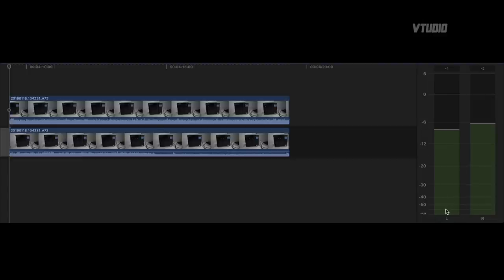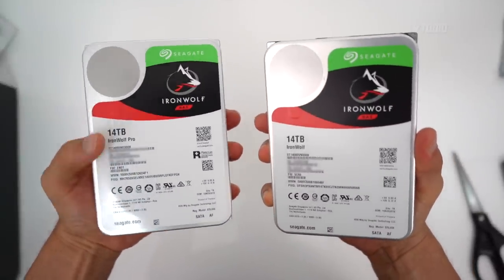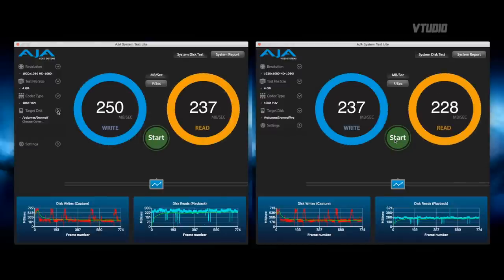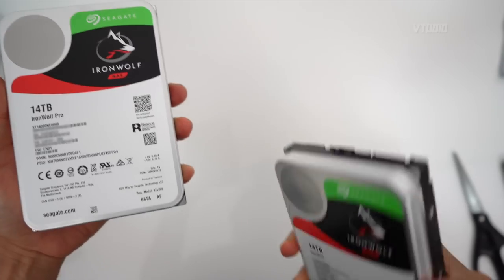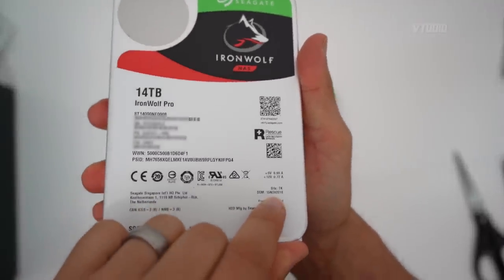With the Ironwolf on the left and the Ironwolf Pro on the right, the Ironwolf Pro's increased IOPS performance leads to around a 21% increase in noise. Overall, the drives are very similar, with performance improvements directly linked to noise levels. When sequentially reading and writing, the Ironwolf is around seven percent noisier than the Pro. But when accessing many files simultaneously, the Ironwolf Pro's IOPS runs about 15% faster at a 20% noise increase. It really depends on whether you value noise versus performance and the type of operations you'll be doing.